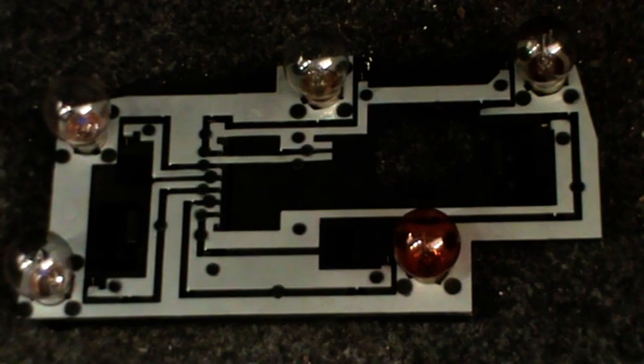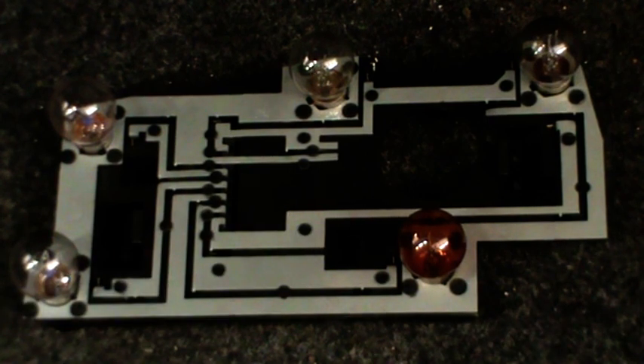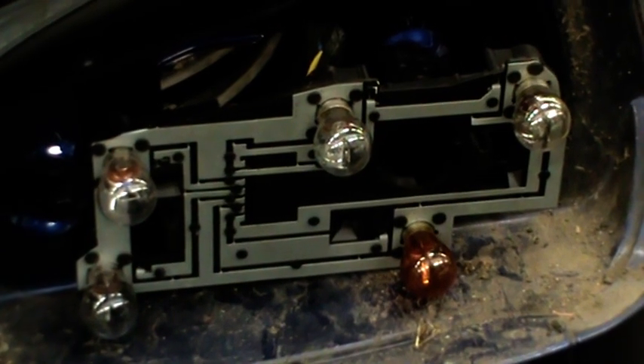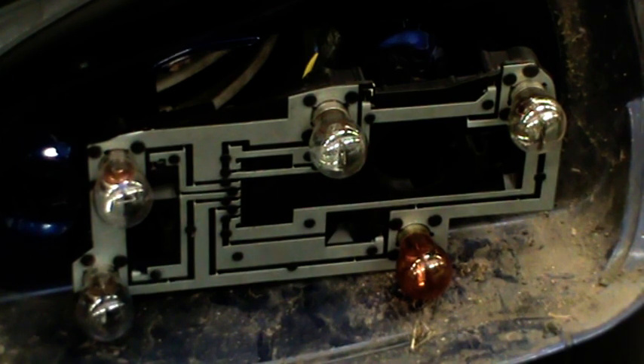Testing is done in exactly the same way as I showed you for the headlight bulb. You'd use a multimeter set to continuity and you just go across the bulbs, checking to make sure there is a circuit through them. You can also check the shared earth as well. At this point I've perhaps changed a bulb or checked the circuit, and I want to make sure everything works before I reassemble the lens - just like I did on the headlight assembly. So now I'm going to run through a simple lights check on the back of the vehicle.